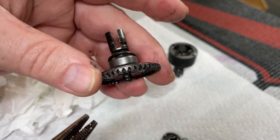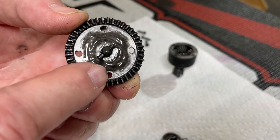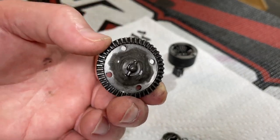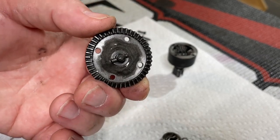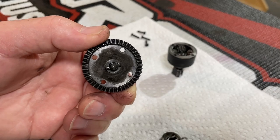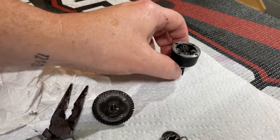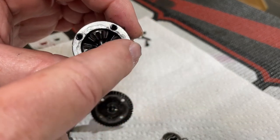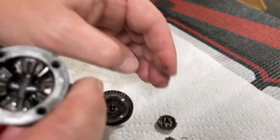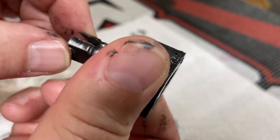Grab the sun gear with a pair of pliers and it pops right off, revealing the locking slot with the pin. That's the pin I was talking about — it breaks, but I won't say all the time. They're pretty prone to breaking though. M2C Racing actually carries a hardened version of these pins on their website that will last and hold on a lot longer — you can also find them on Amazon, eBay, and other places online. On this side I'm going to pull the gears out. There's a gasket here — remove it very carefully and gently with a razor blade, because underneath the spider gears is another sun gear on the other side.